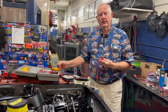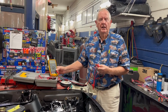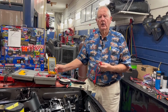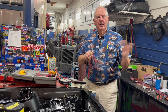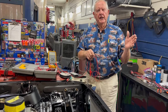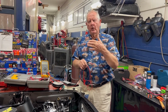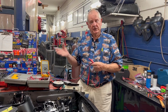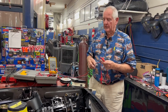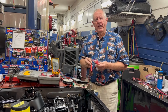And you need to understand, first of all, how to read a wiring diagram. So get your owner's manual out, take a look. It looks confusing at first, but when you start looking, you'll realize that left to right is the front of the car, this is the back of the car. And when you start seeing wires of colors and following with your ruler or pencil, you'll find out where it goes and you get better and better. And if you just have one car, you'll learn the wiring on it pretty quick and you'll probably have a lot of it memorized.